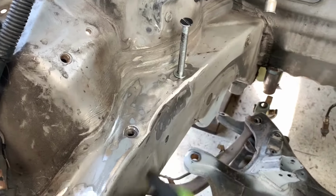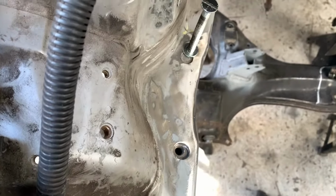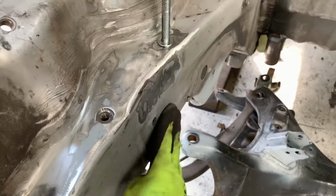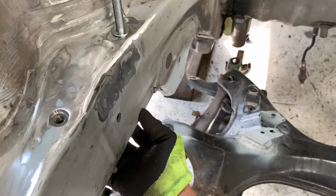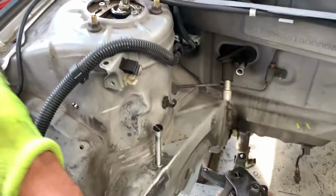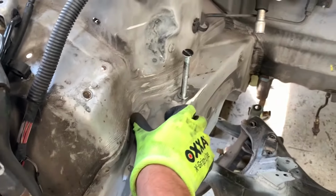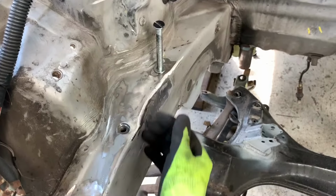We created some space over here. It looks like nothing, but if you look closely you can see that we gained about 8mm over there. The lower part is untouched because this is very thin. It becomes very thin at this point because this is where the front wheel starts to get close to the chassis. So over here the chassis seems really thick, but in this section it becomes super narrow.